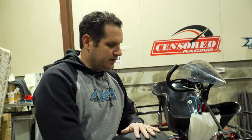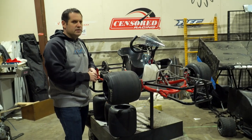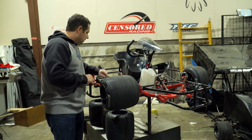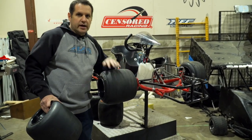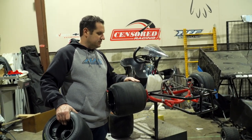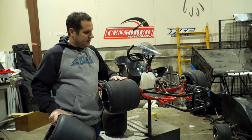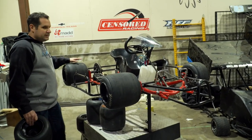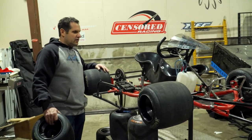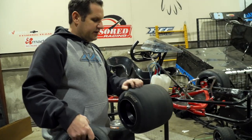You have to look at banking and camber — how much the tire is leaning and how it's wearing. Camber is important, as is everything else. Gear is important too. You hear about tires constantly on these carts, but if you don't get your chassis right, your tires aren't going to make up for it. Tires are the part of the chassis that hits the ground, but if everything else is off, having tires prepped right isn't going to help you. Tire stagger is the same — more stagger frees the car up and helps it turn; less stagger makes it turn less.